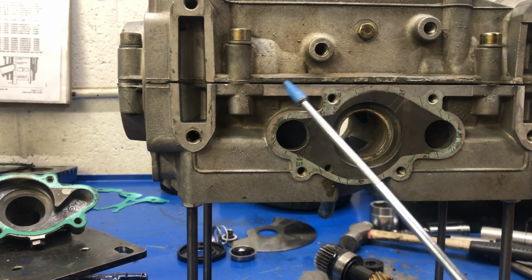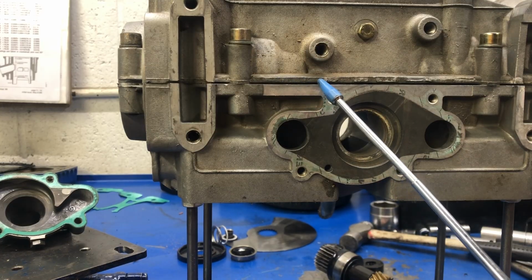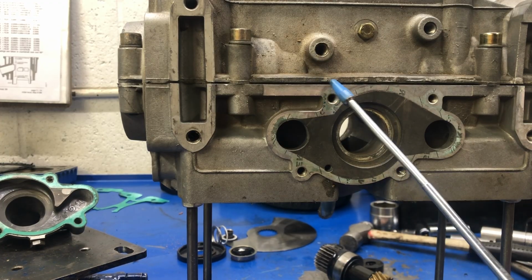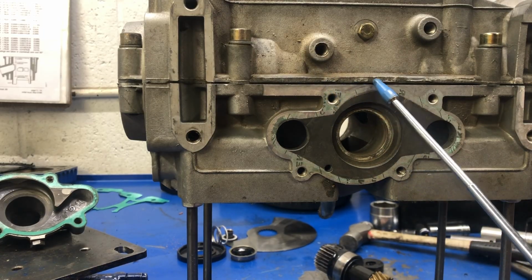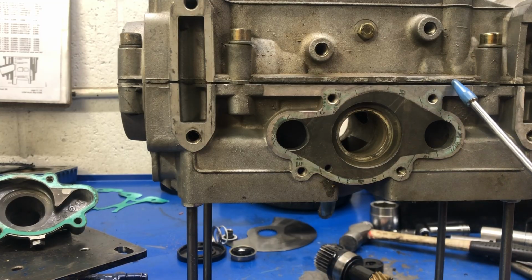There's other places, but it failed right here, so I'm not going anywhere else to check it. And when the engine blows out that silicone, it's going to run poorly. It could potentially seize up, stop. Big air leak in the crankcase. So this crankcase, there's no way I'm going to use this crankcase again. It's been ruined by whoever cleaned this with power tools.